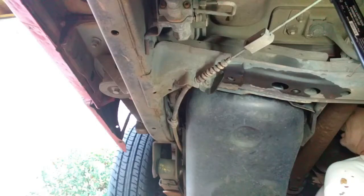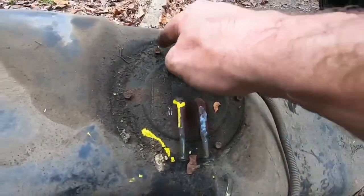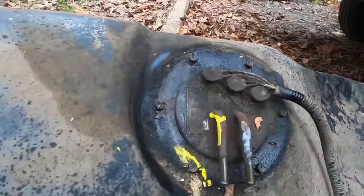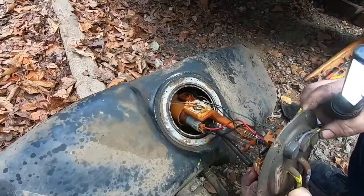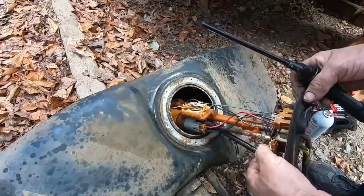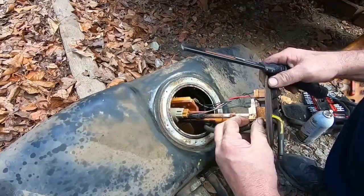It appears to be stuck on the filler neck. Once you've got the tank hanging by its nads, you can see the fuel lines up there that you can undo. Those things look rusty and crusty. I think that's what's holding it up. So we're going to get a screwdriver on there — and we got the tank out. I've just got to take these nuts off. First I'm going to clean this stuff up with some PB Blaster — this way it'll lubricate it as it cleans it. Everything in there is rusty and crusty. It's not good. Seems to be a wire running to the bottom of the tank — we could unplug it up here.